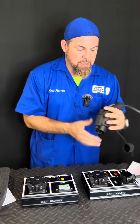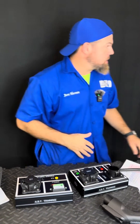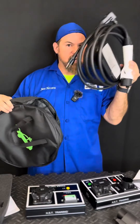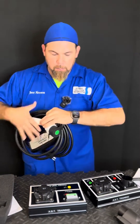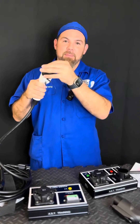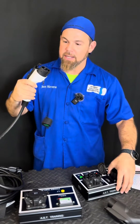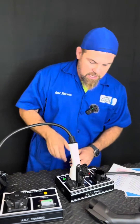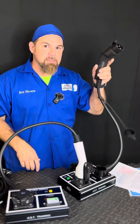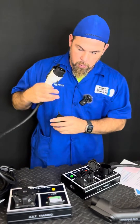But with this, what you're doing is plug it into your car and then your onboard charger. Let's say I have my own onboard charger — I connect this to the grid. Instead of connecting this directly to the vehicle, I connect it to the EV Detective, and then this main plug goes to the car. This one is made for the J1772 only, but it doesn't matter — the majority of plug-in hybrids and electric vehicles use this protocol.